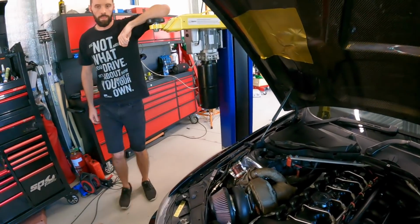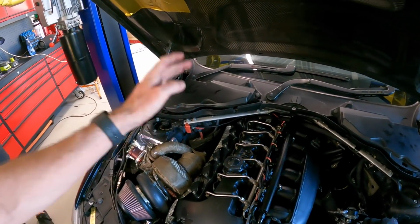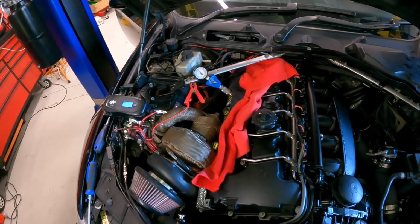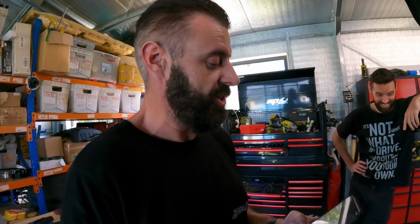We've also done the old switcheroo. We've moved coil number 6 to number 5, coil 1 to number 2, because cylinder 6 and cylinder 1 were the ones that were misfiring today, and we did a compression test. We've done a compression test on this stock motor that's been run at 35 psi with 18 degrees of timing, 8,000 RPM rev limits. I feel like we've thrashed it and we've hardly driven the thing.